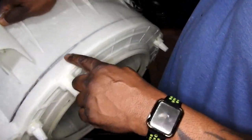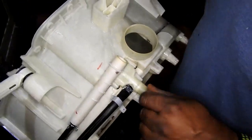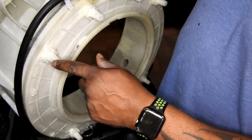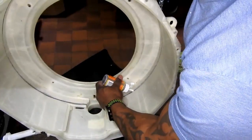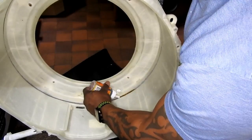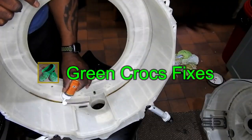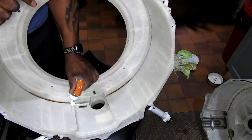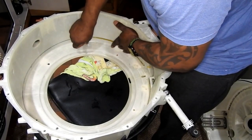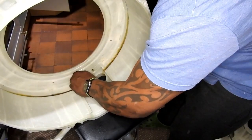I'll show you the underside — the drum almost cut through the top all the way along the bottom. There are tiny holes here, so I'm going to use this Gorilla Glue to fill the gaps. The reason I use this glue is it's weather resistant and as it dries it expands, so it's going to fill any of these hairline holes. I'm putting a bit of sellotape over it to hold it in place so it doesn't run and make a mess.